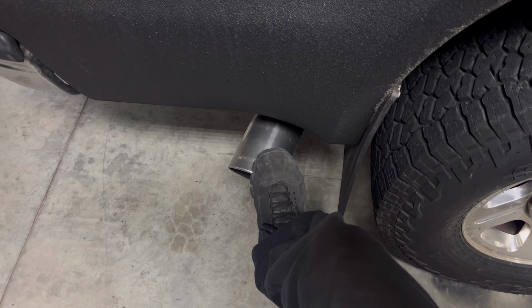If you want exhaust, you're going to have to buy new exhaust. So before you go put exhaust on your truck, I'd just assume throw the exhaust away and start with a fresh install right now. One that hasn't had the crimp lines and hasn't already been put together. Because in the back where I need to take it apart, it's got U-bolts. You will not be able to separate that.